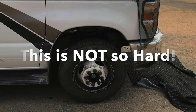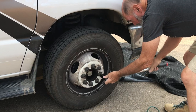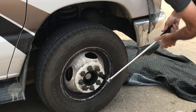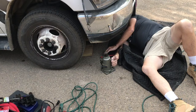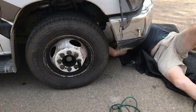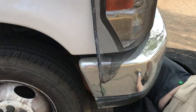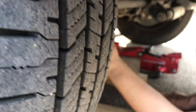After removing the wheel cover, take a half-inch drive breaker bar and break loose the eight lug nuts that are on your wheel. Then, with a 10-ton jack, jack up the frame of the car and get the tire just about a quarter of an inch off the ground — no more than that. And I'll tell you why in a few seconds.